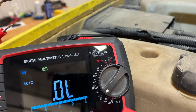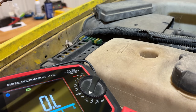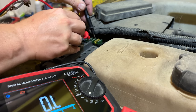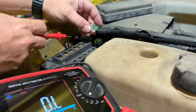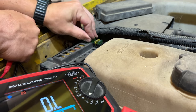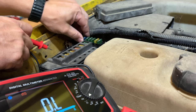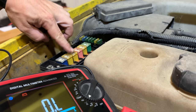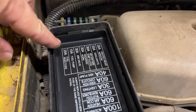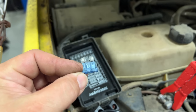I'm going to set my multimeter to test continuity. Now if I touch my two leads together, it beeps. Over here is the fuse box — I'm going to test all these fuses real quick. If it beeps, they're good. That one right there might be bad, but it's good — there is a lot of corrosion on the blades though. Down here are bigger fuses. Those are all good. The fuse that was relevant in this case is the second one on the left, this 15 amp fuse here. It is a bit corroded, so I'm going to replace it because this is a very important fuse.